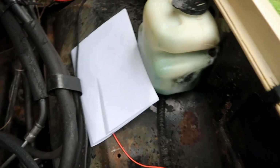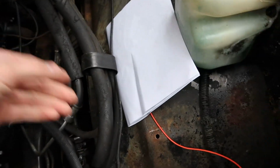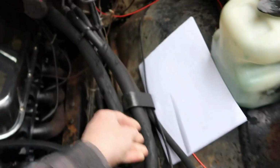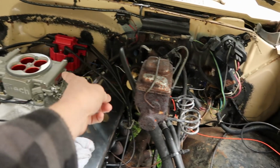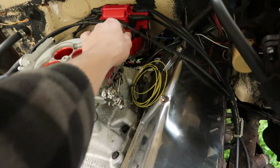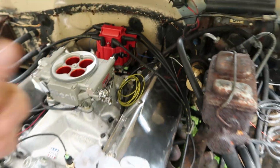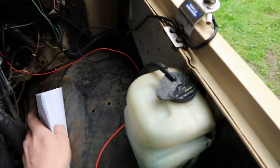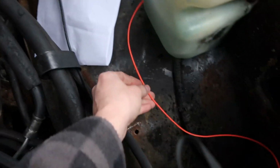Find a nice one. And then the fuel line that runs out of the high pressure, out of the pump, that will run along these power steering lines over the firewall, and it'll come in the back of the motor, and I'll be going right to that fitting right there. So I'm trying to keep everything around the motor. Everything is, yeah, the rain's starting to come down good.